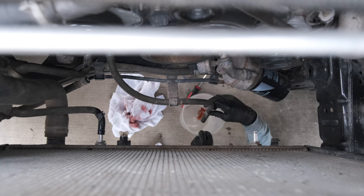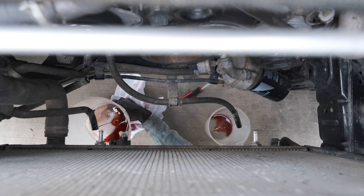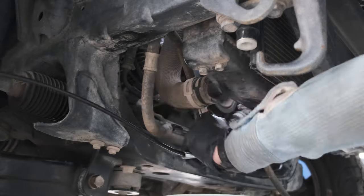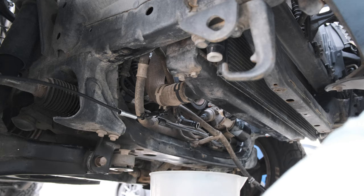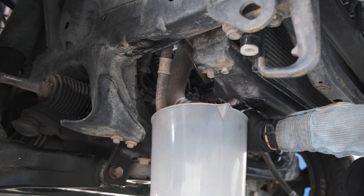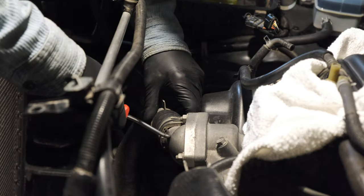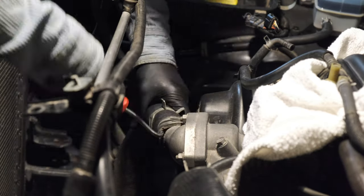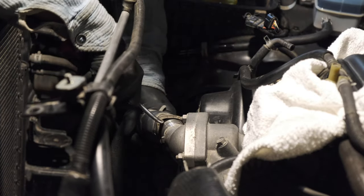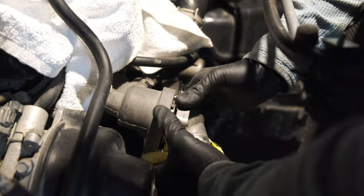I used a couple of smaller plastic beakers just to catch the residual coolant in the lines. Next I'll tackle this larger hose on the left. Especially with these heavier duty constant tension clamps, having a pair of hose clamp pliers was pretty helpful — they kind of lock in place so you can just focus on moving that clamp out of the way. It's a really good idea to wear safety glasses, mainly because you're working with fluids that could damage your eyes — and that actually did splash all over my glasses. I let that hang out to drain and moved on to the thermostat. Using the longer metal hook and sliding that in the water inlet, I worked that around the radiator hose until I was able to pry it off. The water inlet has three 12mm nuts, and mine had a little extra sealing on it, so I needed to give it a few taps to pry that loose.